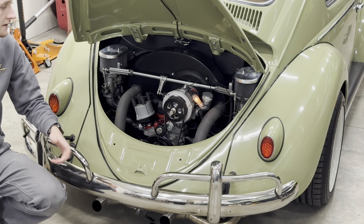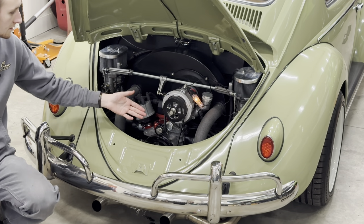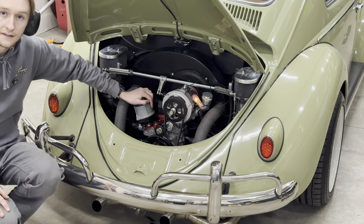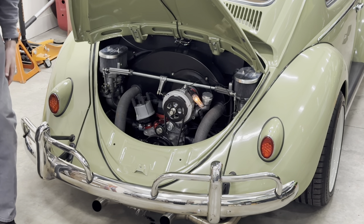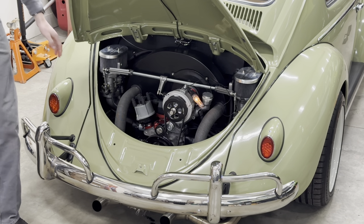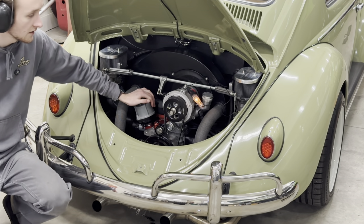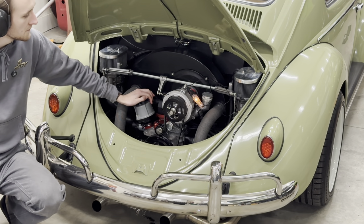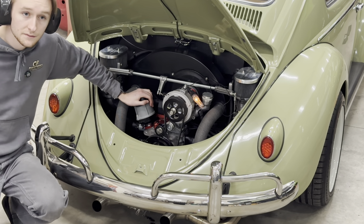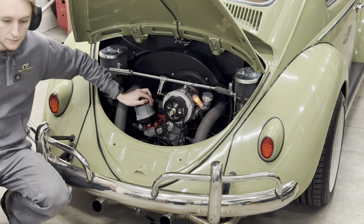When I have the coil connected to the alternator, the light is on when the key is in the off position, because the alternator has a live going to it. But when I turn the key on and start the car, the light goes out. And when that circuit is happening, my multimeter reads that the alternator is putting out 14.4 volts, which means that it's charging.